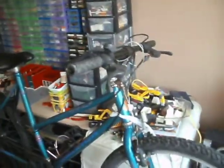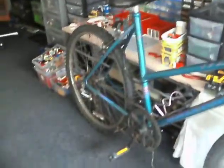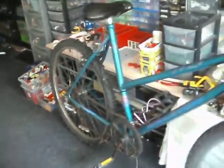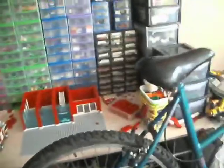Because even fixed up, it's still a 20 quid bike. But to be honest, with a new chain on it, perhaps a lick of black paint on that crank, a good clean, replacing these rust nuts with some nice ones, and replacing the hanger for the front brake cable if I've got one - may not have one identical, but I know I've got some - it might be good to go.